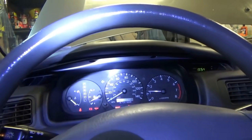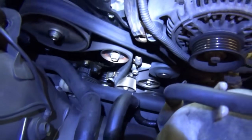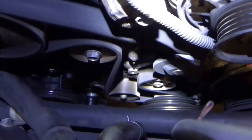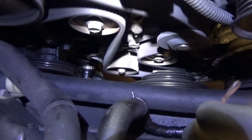Turn off all the accessories — there it is! That's what's causing our noise. You can see how the noise comes back when it does that. The loose belt — it wasn't necessarily hitting the cover, but when the belt vibrates like that it'll make noise. So we're just going to throw a new belt on here and also replace the gasket around the oil pump — you can see it's leaking right here.